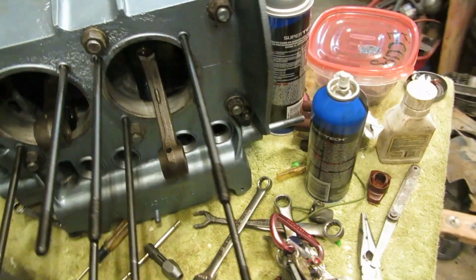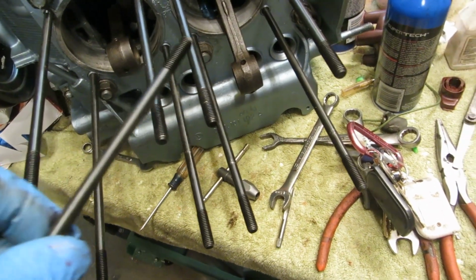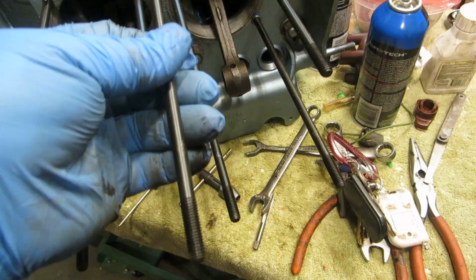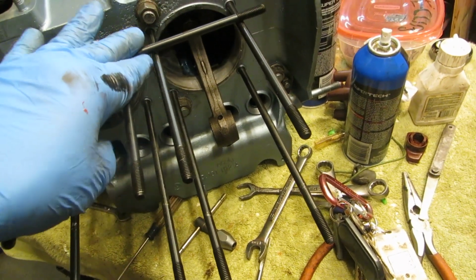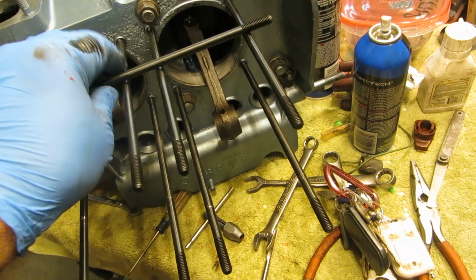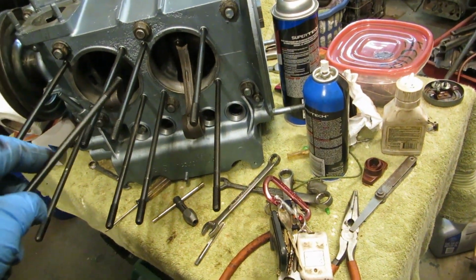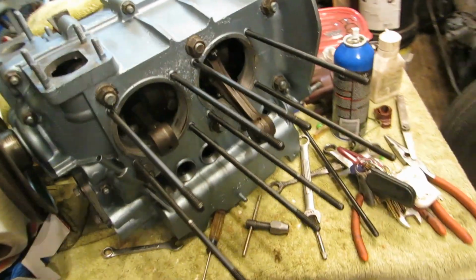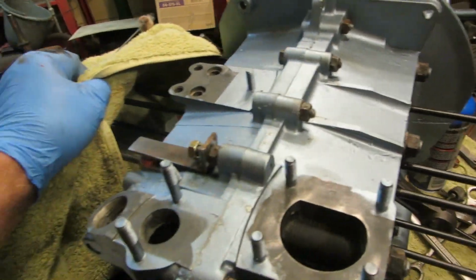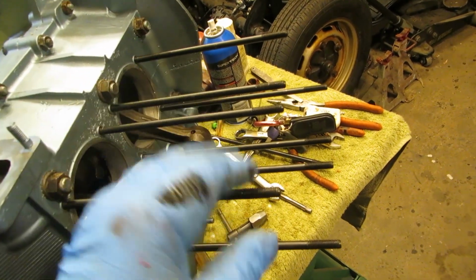Well, we have our head studs in, and to the folks at Empy, I'm not amused. Essentially, there were 7 short studs and 9 long studs, and if the person who did that is snickering, I didn't find it funny, but I got one up on you because I have several small studs, so I just used an original Volkswagen stud. So joke's on you, Chief. How about that? Oh, it's not chromoly. I'm gonna make 53 horsepower here, dude. I don't know, some people.